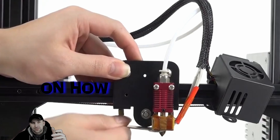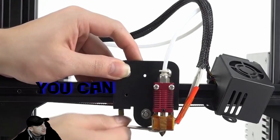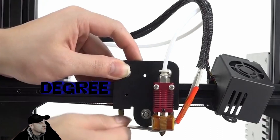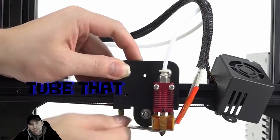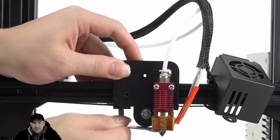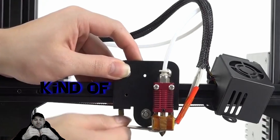That's a quick simple fix. If you want us to go through and show you how to do all that, we can actually make a video on it — but this covers the issue and the fix. You can take all this apart and get that corrected. Now the second issue: you see the filament tube here. These filament tubes are only meant to get up to a certain temperature, so if you have the existing tube that came with your 3D printer and it isn't rated for high heat, and you turn the temperature up too high, the tube going down inside will slowly bubble out.